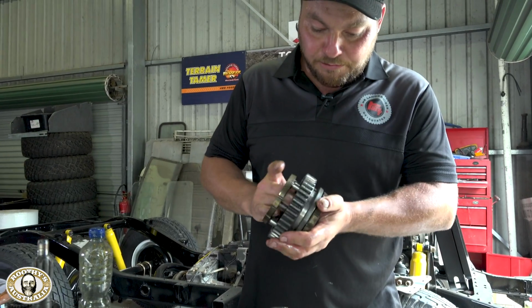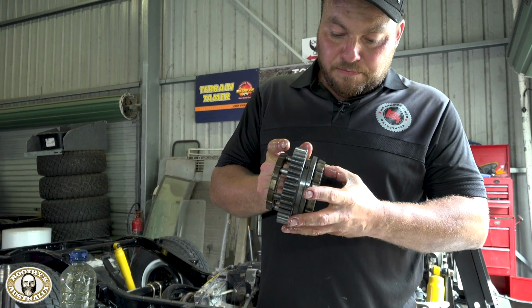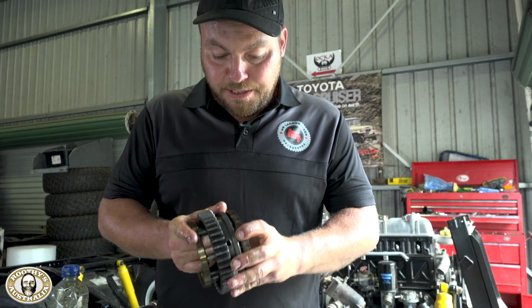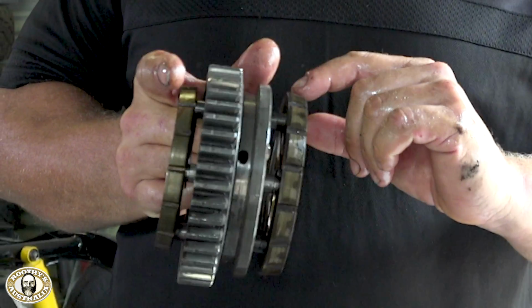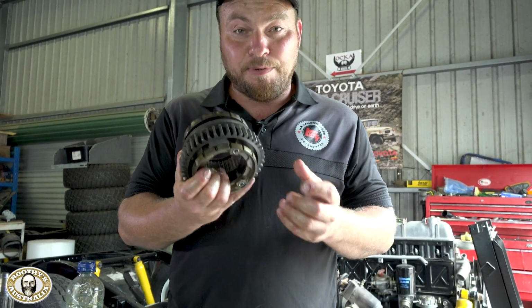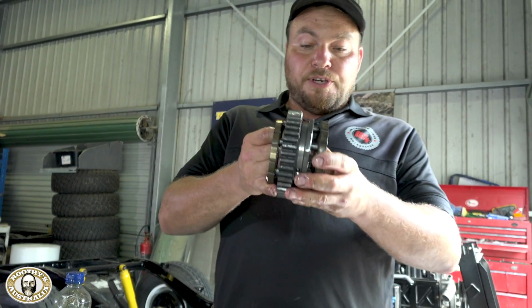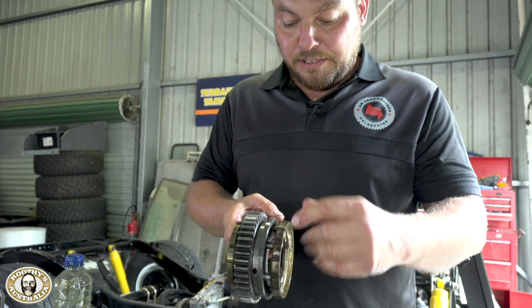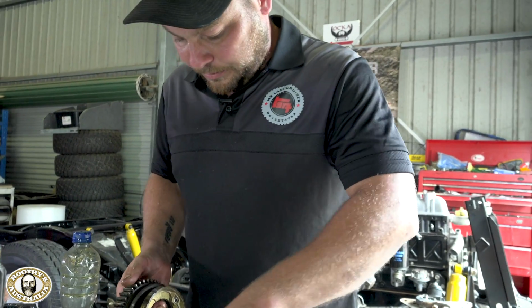We'll get our third and fourth synchro. Now we've cleaned this off. The synchros are all right on this. We've checked them. They'll go again. Otherwise, you'll see they're flat. There's no teeth left, and you'll be crunching gears. So if that's the case, you will need to replace this whole third and fourth gear synchro hub, and this also has the reverse gear in it as well. So we'll put this back on.